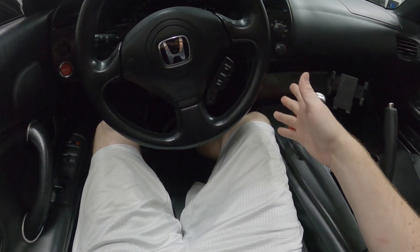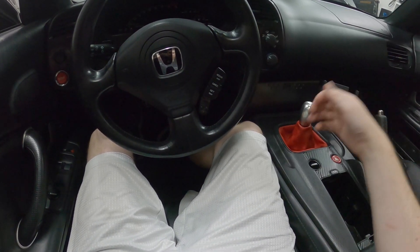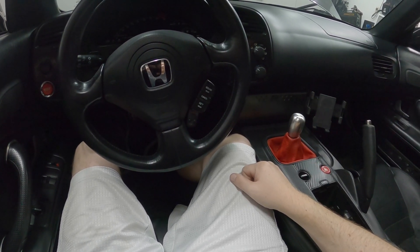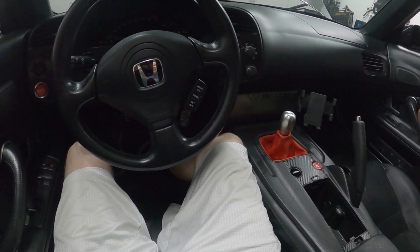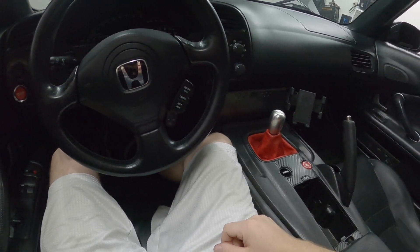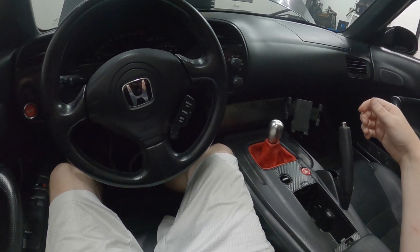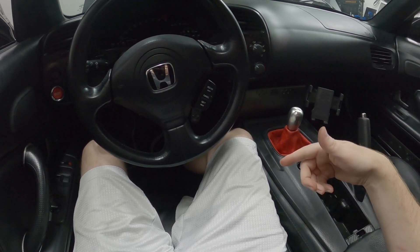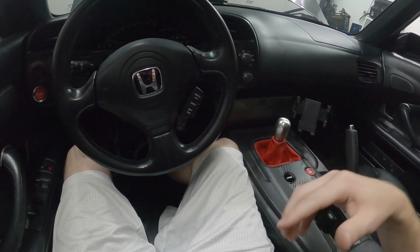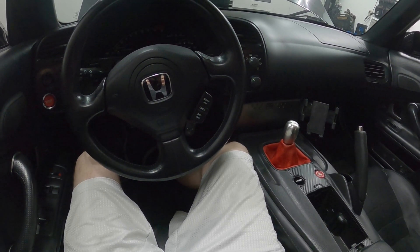This mod will help alleviate additional wear to the thrust bearings caused by the heavier clamping force of the clutch. In my case I have the ACT heavy duty clutch with the OEM friction disc, which is what a lot of S2000 guys run. I don't know definitively if it's an issue, but for as easy and cheap as it is — the relays cost about $13 shipped — I think it's worth doing. I enjoyed doing it anyway. Got everything done, pretty happy with it. More videos coming up covering the clutch, the interlock bypass, the fire extinguisher — we're making progress. Thanks for watching.